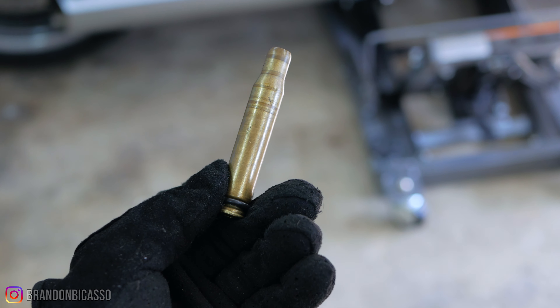There are so many people that don't know what's involved with the V-rod, which is why I'm being so detailed. I call this the ammo shell — that's what other people call it too. This is not what causes the oil leak. The o-rings tend to dry rot from old age, and oil breaks down components. Also, the tube that goes on top of this is what ends up dry rotting and causing leaks — oil coming from the breather up into the airbox tends to seep past and go everywhere. This component is part of the problem, but not the problem itself.